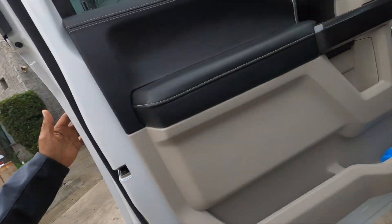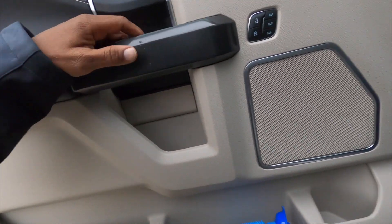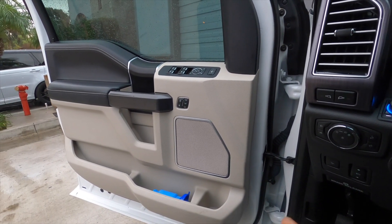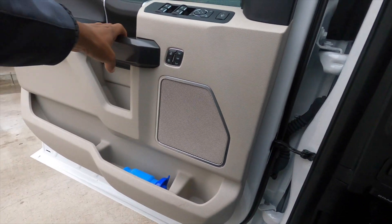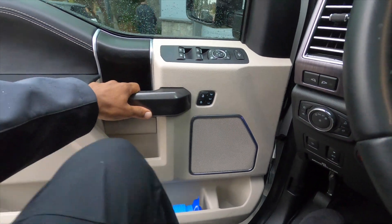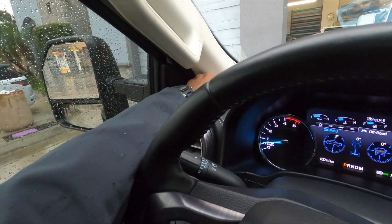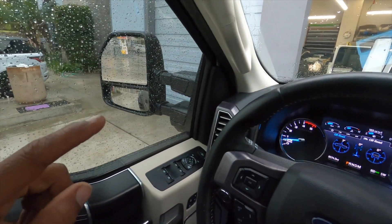For the front, we took the Mille ML 1700.3s and put them in the door. We deadened those doors as well. Then we took the ML 280.3s and did the tweeters up there. In a lot of our installs, we do it so that when the system's in the car you can't see anything. In this particular case, everything is stealth — including the box and the DRC.